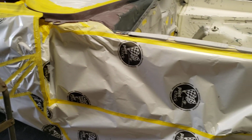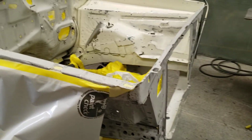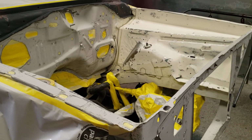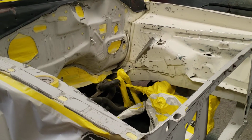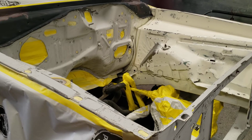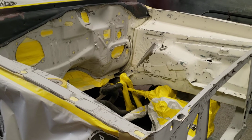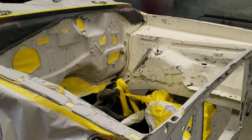So, we're about there. We're all wrapped up and get out here tomorrow morning, probably about 9:30 or 10. That's when it starts warming up good. Probably take me 2 or 3 hours to paint it, I'm figuring. And then wait an hour and then put the heat to it. Let the heat go about 12 hours.